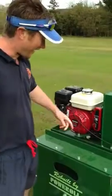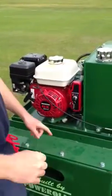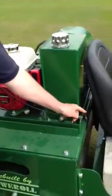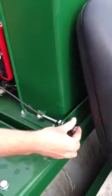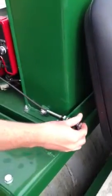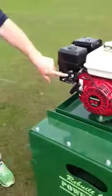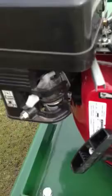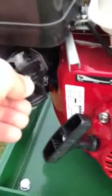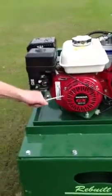It's real tough actually. Off to on. This is your speed indicator, so you want to pull it out just a little bit so a few revs, and then twist it to the left so it holds it in there. Then we want to pull the choke out if you're starting it from scratch, so then you'll hear a little click. This is this little grey thing.